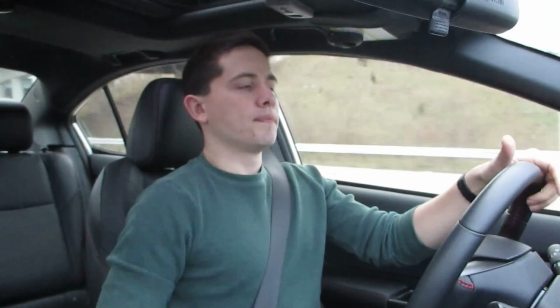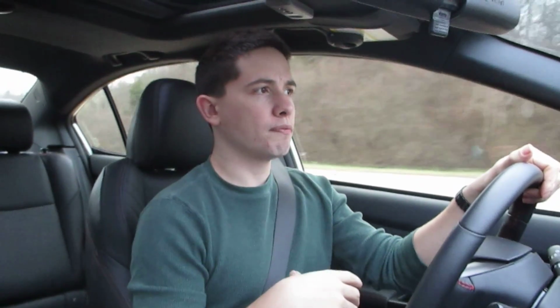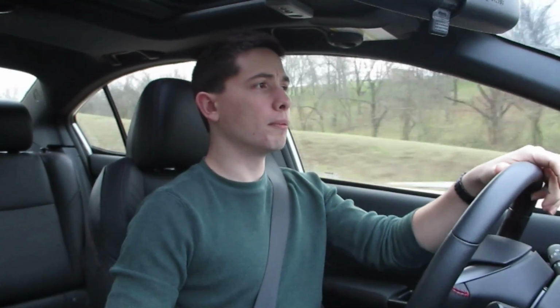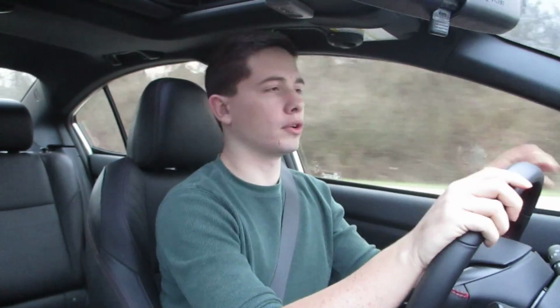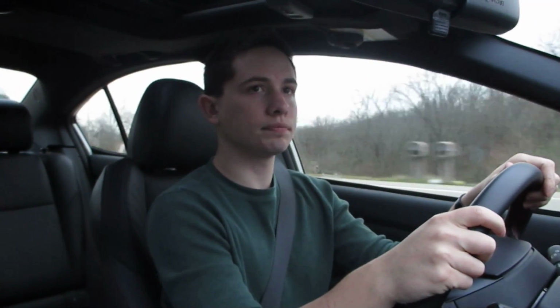And then on top of that, much of your throttle response was, if you stepped on the gas 10%, the car opened up 50%. If you stepped on it 30%, it was like 75%, and then half throttle was basically full throttle. So between that and the rev hang, it was kind of difficult to drive the car on a daily basis. Not necessarily difficult, but it just didn't feel like you were telling the car what to do, and the Cobb Accessport has definitely helped with that.